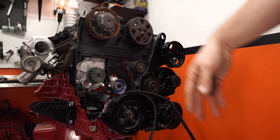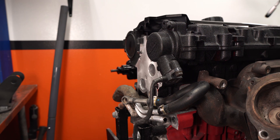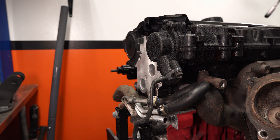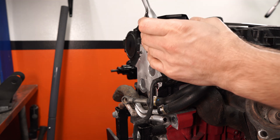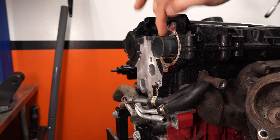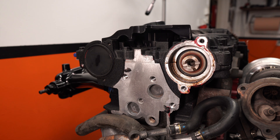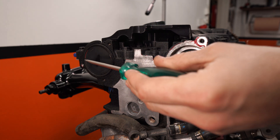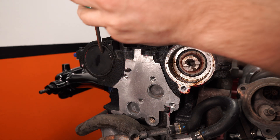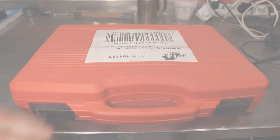It's time to remove the VVT. We're going to head to the back side of the engine and put the cam locking tool in place. Let's start by removing the cam sensor on the exhaust cam, because we only have one VVT on this engine. It's held in place by two 10mm bolts. You're also going to want to remove this thing right here - inside there you'll find a 10mm bolt, because you want that exposed. And remove the cover on the intake side. I'm going to be using this tool kit - all links are in the description below.